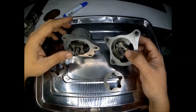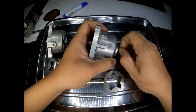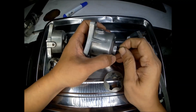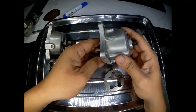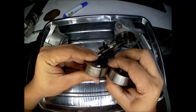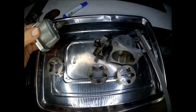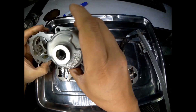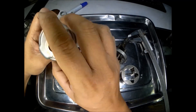The upper part is assumed to be of the same height and same thickness. This is the reason why the Mazda RX-7 FD oil pump is better than the Mazda RX-8. Also, you cannot interchange the oil pump — different bolt pattern, it will not match.